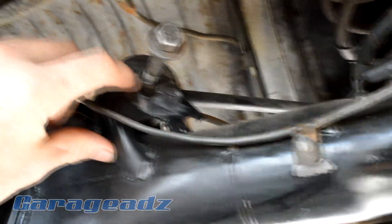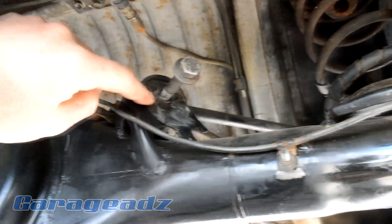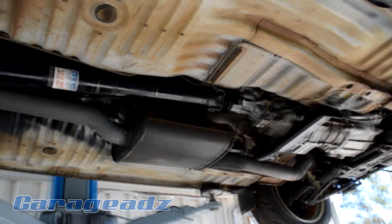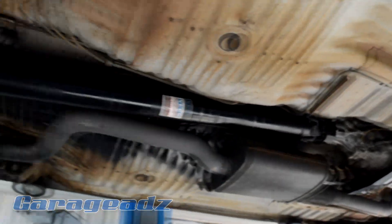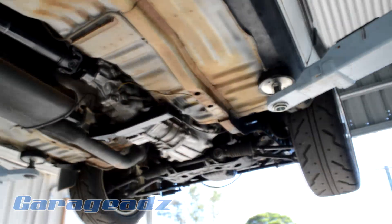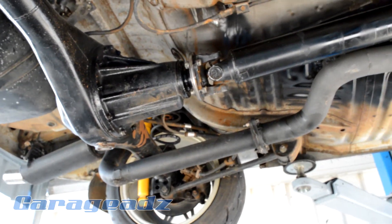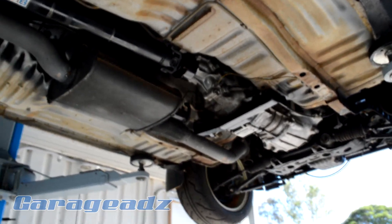My issue is that these bolts keep falling out. What's actually happened is the bolts have worn this out. The fix I'm going to do is to weld hardened washers to the outside, at the same time fixing the pinion angle, and it should assist my traction problems. The angle of the gearbox doesn't match the angle of the diff pinion, and this can cause all sorts of dramas. Once those are fixed, should be on the way to recovery. This motor makes a fair bit of power — traction is a very, very important factor in this car.